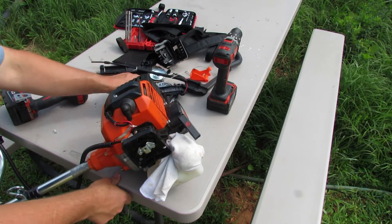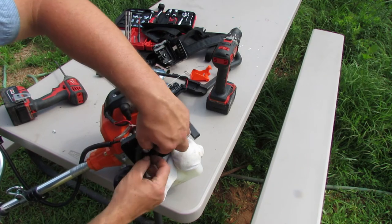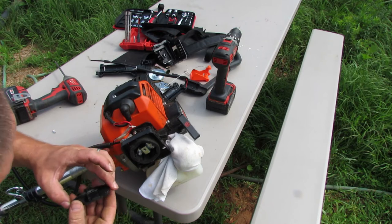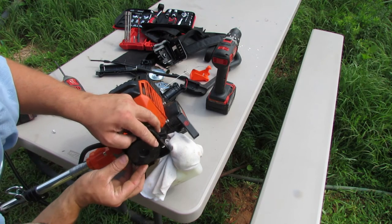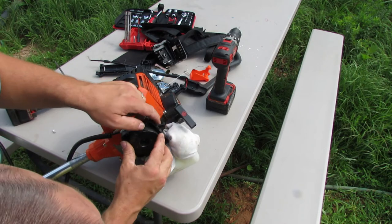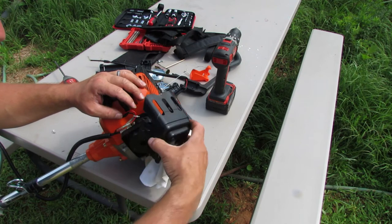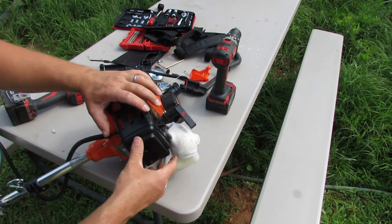All right, air cleaner goes back together. I need the filter, which is here. That just stretches around all these little plastic pins in here. So that's nice, just like that. And then this air cleaner had two little plastic pins in the base there that fit into those plastic holes, and that doesn't look like it lined up too well, so let's try it the other way. Yes, that looks much better. And then our cover here that goes over top of everything, got to kind of fish it around that choke lever, and it fits right on there just like that.